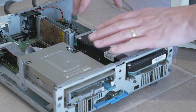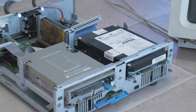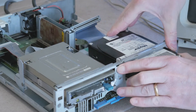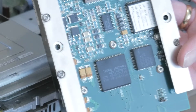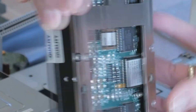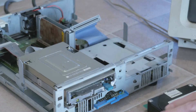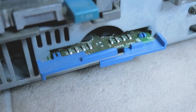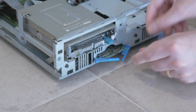The construction of this machine is such that you can take out many of the parts by hand without needing to remove screws. After disconnecting the hard drive via its edge connector, we can release a clip at the front and slide it out. Apparently the interface used on this drive is known as XTA, modified by IBM to include power pins, and it's an old 8-bit interface with similarities to the IDE parallel ATA interface that became standard for many years. This drive is a Maxtor 40MB model, matching the specs of drive type 39 in the original IBM AT BIOS. The front of the machine has a removable RAM card — the model 2011 motherboard has 512KB of RAM soldered in directly, but it was common for the machine to come standard with this card that extends it by a further 512KB for a total of 1MB.